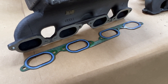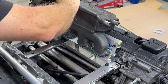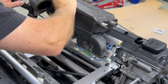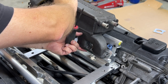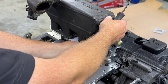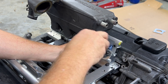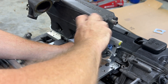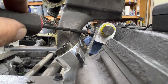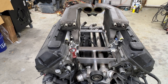Use the factory gaskets on the intercooler-to-adapter joint. Align the first hole loosely with a piece of hardware and then install the rest of the hardware. You'll want to lift the intercooler to the top of the adapter before final torque. Note the space available for the injector harness and the injectors' alignment. Install the opposite intercooler the same way as the first.